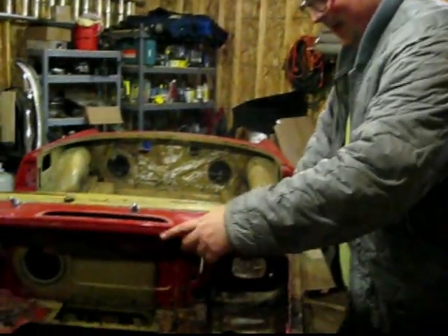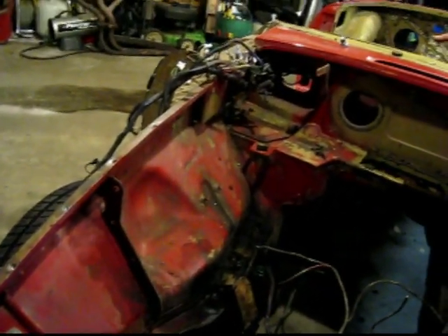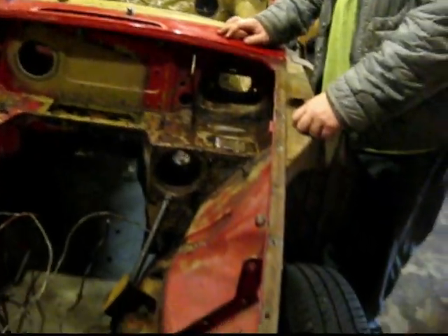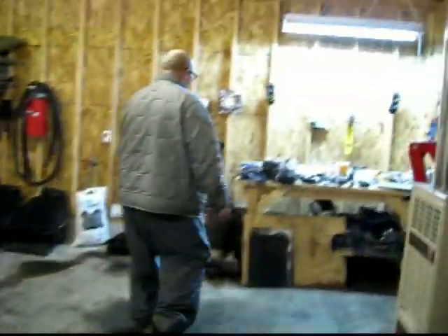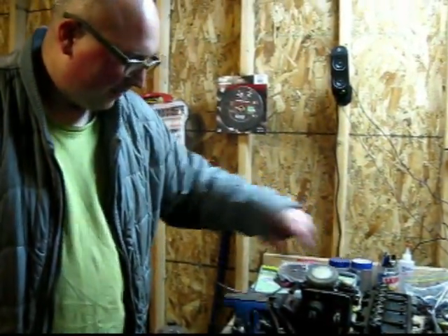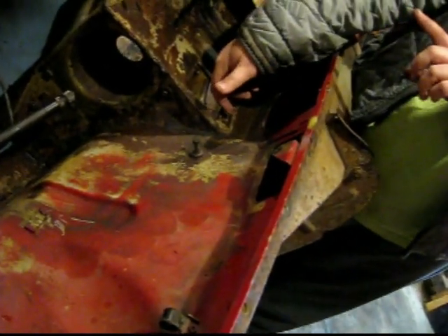Other than that, as you can see in the engine bay, I've got all the brake lines, gas lines, and the wiring harness just kind of laying there — I've got this all taken apart. One of the big things was getting the brake and clutch master cylinder assembly taken off. There was one screw that was tricky — this front one on the left — kind of hard to get in there with a wrench, so I had to use that extension again. I think it was a 12 millimeter socket.